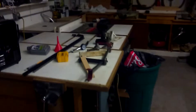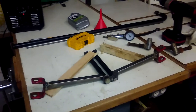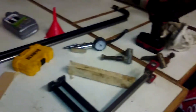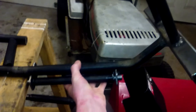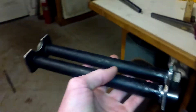What's up. I'm working on the A-arms here — that's really all I've got going on today, but I'll talk about it a little bit. This guy here is where it's all going to pivot, where both of them are going to pivot. And these tabs are going to weld up underneath the frame. And that will be the suspension.